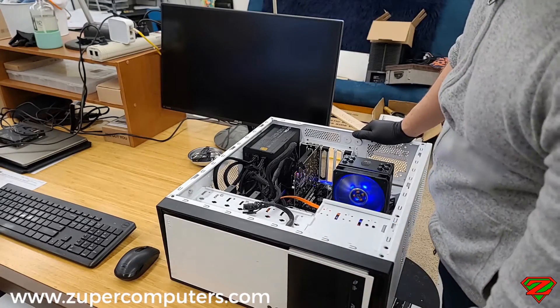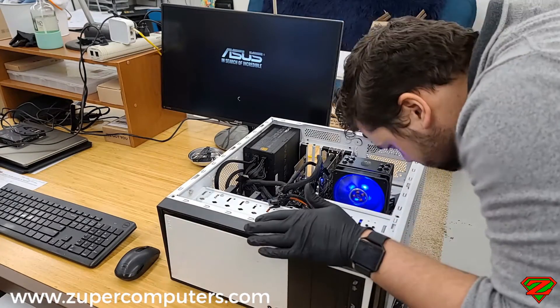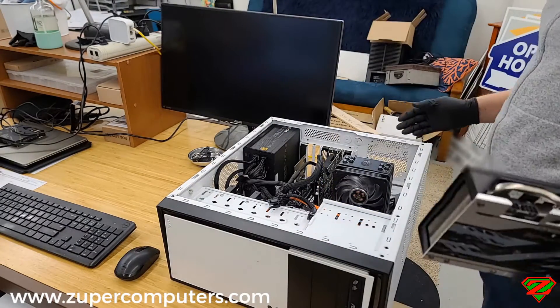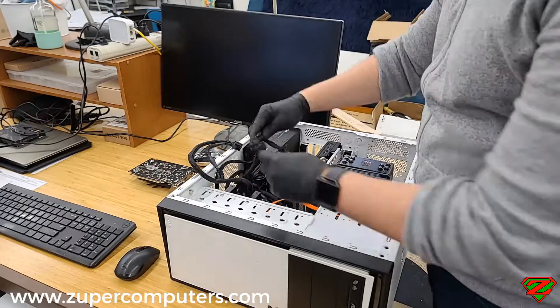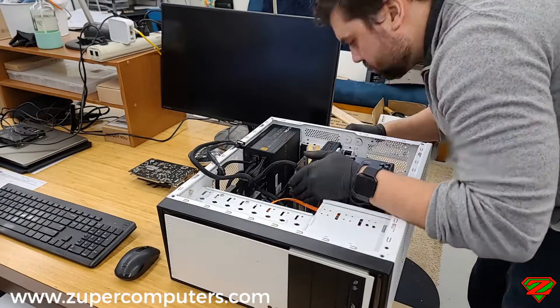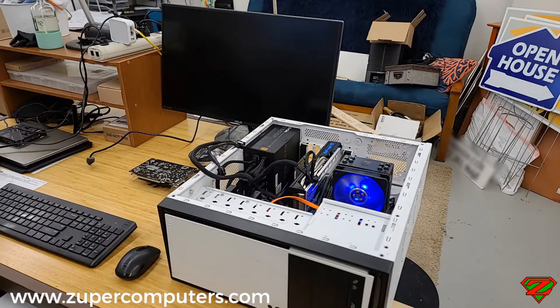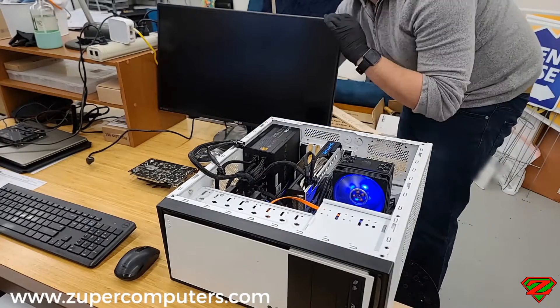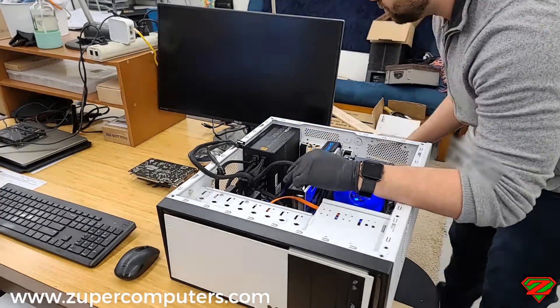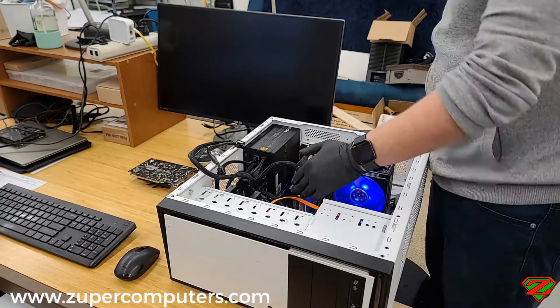I took out the damaged card and got my computer to boot up properly, which it did with video out. Then I swapped my RX 560 into the slot to confirm my test system was working and that the PCI slot was fine. The card hadn't damaged my system. I also checked and double-checked all cables, then tried different outputs — the card had DisplayPort and DVI — testing each one to see if any were working.